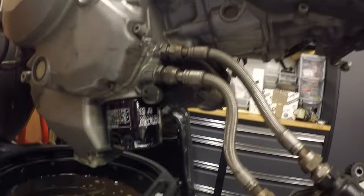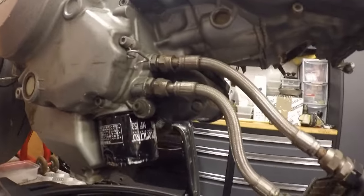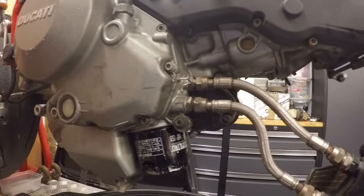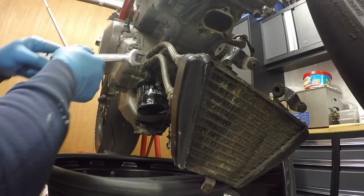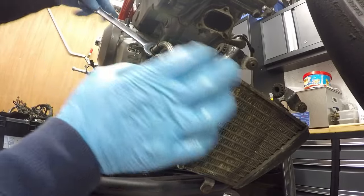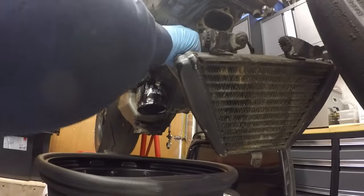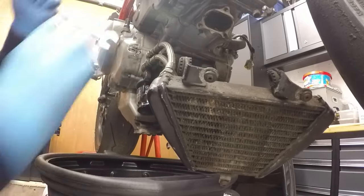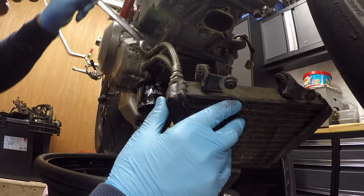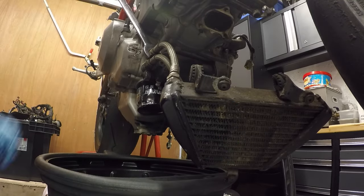Okay, two oil cooler lines, and then that's the oil circuit completely drained. So hopefully it'll reduce mess as I shift the engine around. So let me set up to get this taken off as well. Okay, so these are 19 mil. Loose, good. Okay, that one's binding a little bit. Now, the top one is actually taking it out of the engine, so I'm just going to need to get a second 19mm spanner.